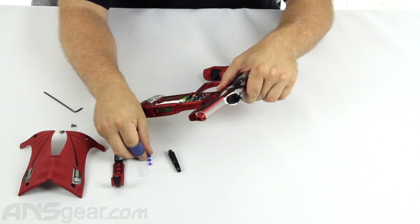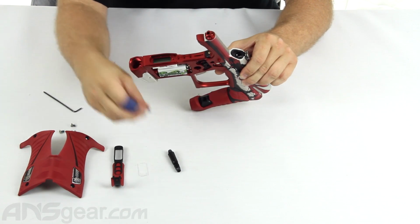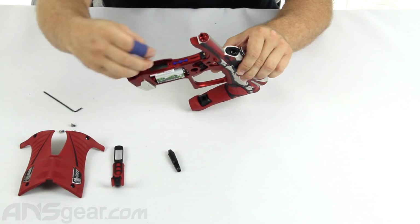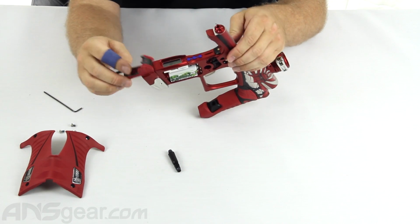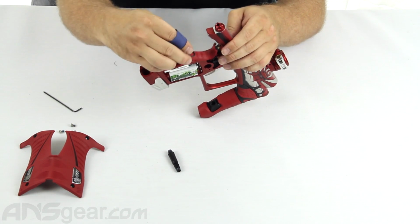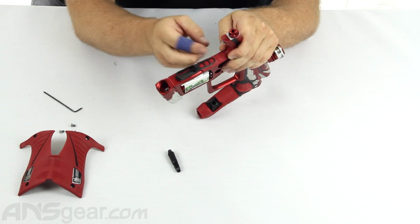Next, we're going to put these back together, our back button pad. So we put our button strip in, make sure that it doesn't fall like that. Keep it in the holes. Put our window on right there, and then we're going to hook up our button strip here. See that it does have two little notches at the top. You want to hook those in at the top right here, and then you have a tab that's at the bottom of this piece too.